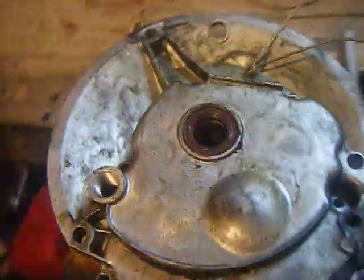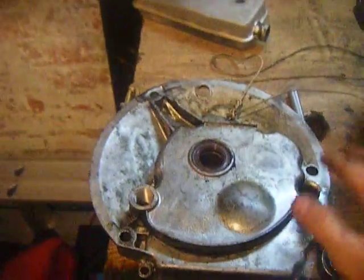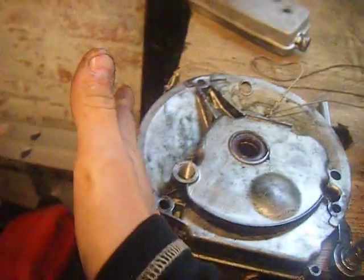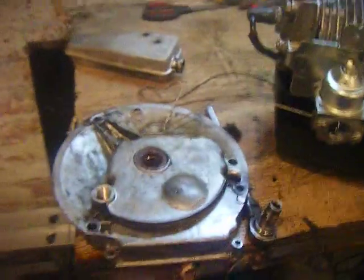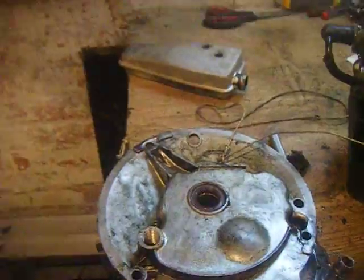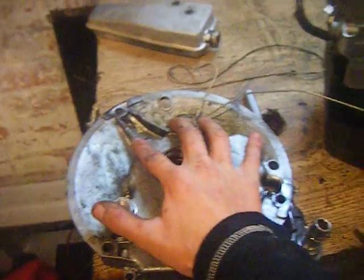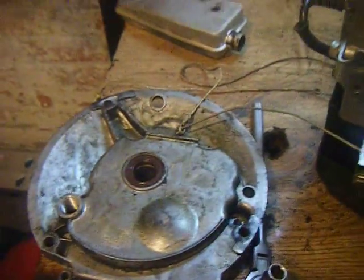Yeah, that's no real problem. What I'll do is get a sheet of steel, drill or bolt or rivet some metal to either side, weld that to whatever you want to put it on, and then voila. Then just cut something in the middle for this area to sit in, drill the holes, and it'll just bolt straight on. You shouldn't have any problems with leaking oil.